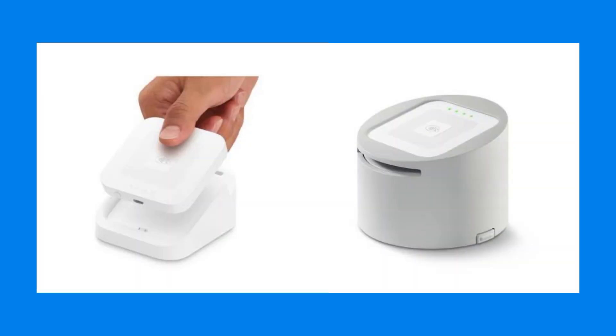Plug it in for at least 20 minutes. Use a small object, e.g. a paperclip, to press and hold the button for 20 seconds or until the red lights stop blinking. Release the button, wait 10 seconds, then press the button again to turn it on.